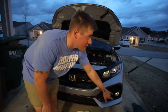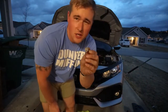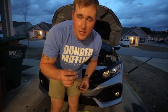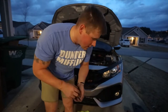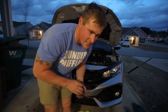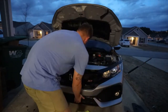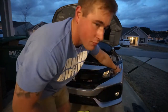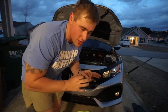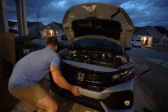On each side of the bumper there's going to be a 10mm bolt right here — you'll see it under the fog light. Then there's going to be an Allen key bolt directly to the left or right of that, depending on what side you're on. There's also a bunch of push tabs under there — about 8 to 10. Once you do all that, you should be able to pop your bumper. You'll also need to pop it off the fenders. Then pull your bumper off, unplug the fog lights, and you're good — just be careful nothing falls on you.